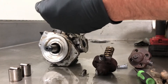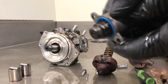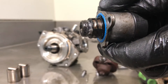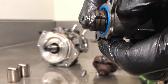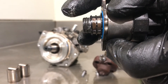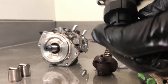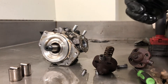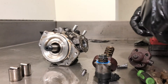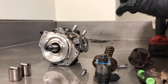If you suspect your pump's bad, first thing I'd check — while it's still in the truck, take a few things off — this regulator here, the screen. If you've got metal buildup on it, your pump's junk: new injectors, rails, lines, strain the tank. I'd suggest doing a CP3 conversion, or if you do a CP4 at the minimum, definitely put a lift pump on the truck. Save you some headache.